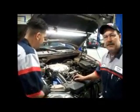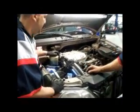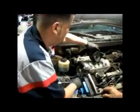Hector has been working on this engine for some time now to get to this point. He has some of the covers off and the air conditioning is all emptied out. He's getting ready to remove some more parts. In order to do that, you have to take the motor mount off, and then you have this bracket here that comes off also — it's a little tight in here. Now you have access to the timing belt.